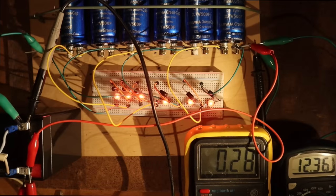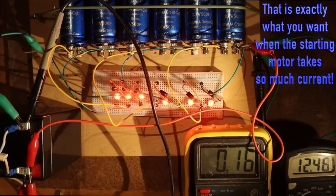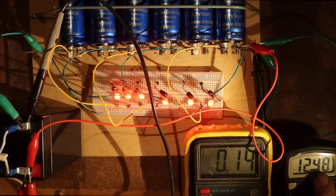So now the current goes again to the capacitor. It's 280 milliamperes going to the capacitor. So that means that the capacitor should have less voltage than the battery. Otherwise the battery would never do this. And that's of course because the battery went down more than the capacitor during the compression. And that means that the battery was going lower and the capacitor was keeping up the voltage. And now during operation you saw that it was below 12 volt. And now it's going back up, because a battery is a complex chemical system that recovers itself a little bit after a minute or so.